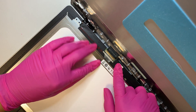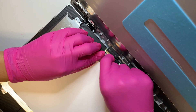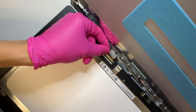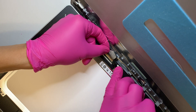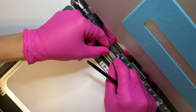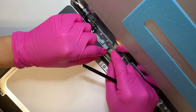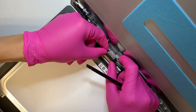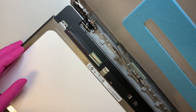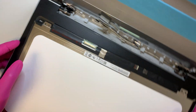This is a 40-pin connector. Let me turn it to the other side — there's tape holding on to the LCD, so first you need to peel the tape back a little bit. There is a small LCD clipper you need to flip up. Once that safety clipper is open, you can pull the connector away from the LCD. At this point the LCD will just come right out without any problem.